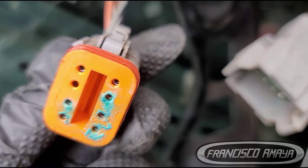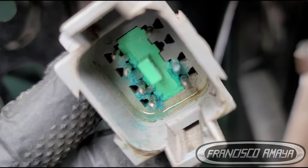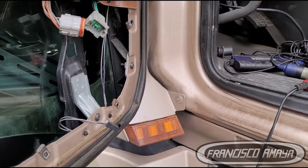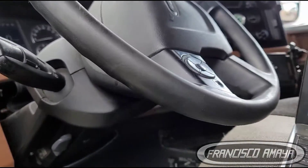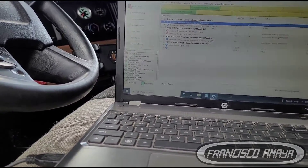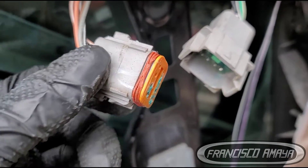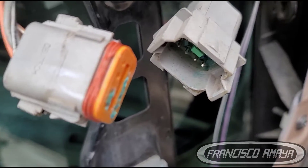That's the reason why we are getting this issue, and there is a lot of corrosion — that's why it looks blue, because water has been sitting here for a couple of days. You can clearly see the damage. This is an example of an electrical problem on these newer trucks, and it's just because we have electronics. The voltage in this case is like 4.5 volts or 1.1 volts when the system is working. When the voltage is that low, anything like this will short because the voltage is too low to actually push through.